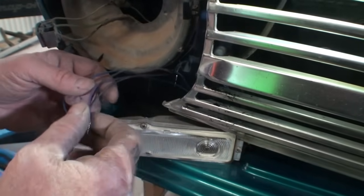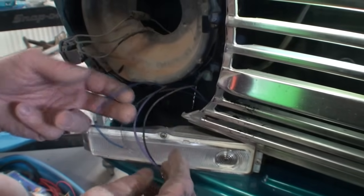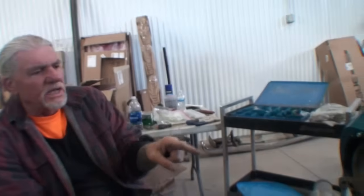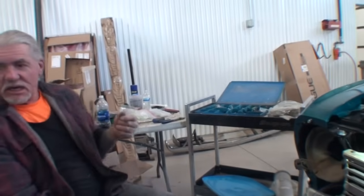The brand new wires that you see here — that's the pigtail I had to buy. But the problem we've got is when you turn the key on, the right turn signal is stuck on. When you go to do the left turn, it does nothing. When you put it to stop, it does nothing — turn signal is still stuck.